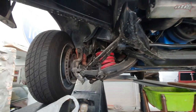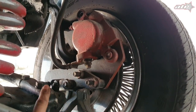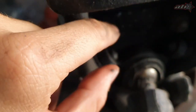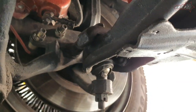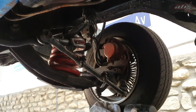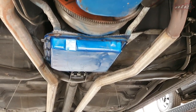I went through all the bolts here — everything was loose, really everything. Same thing on the sway bar bolts: I can just take them off with my hand. So yeah, go through every single bolt on the car, on the frame, because of the hydraulics — stuff just gets loose like that.